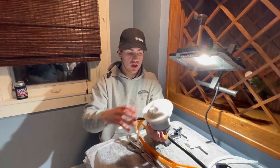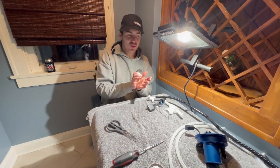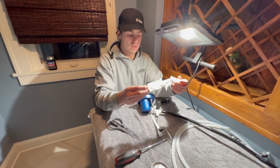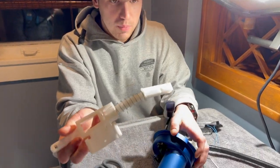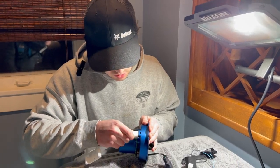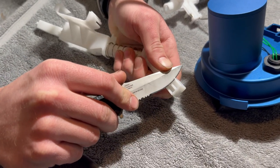This is what the disassembled factory top hat looks like. I took it outside because there was dripping fuel making the place stink. Now we're mounting the float assembly onto the new regulator. It has little indents that are a hair too thick, so as Precision Raceworks recommends, very lightly trim the plastic off the edges to make it just a little bit smaller.